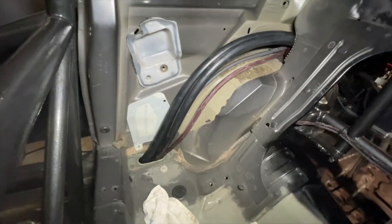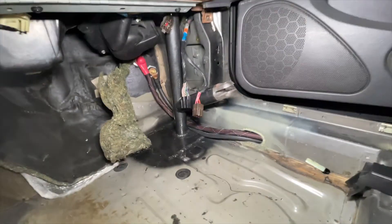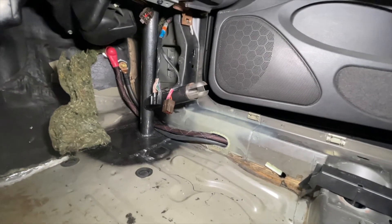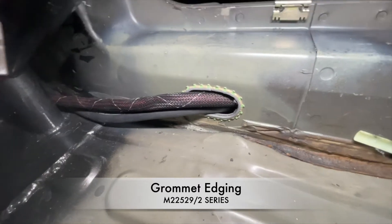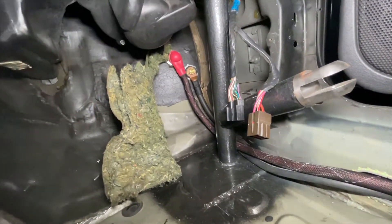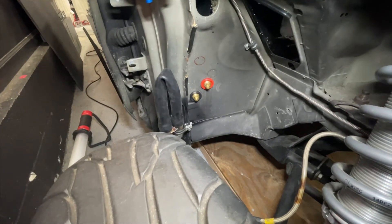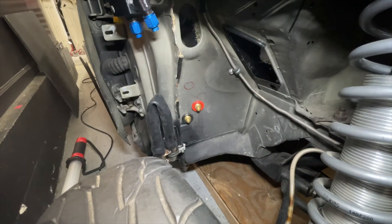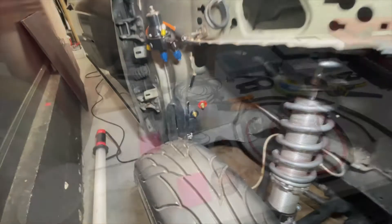That's the slot I cut — previously discussed — where the wires and hoses go inside through that area and out through the kick panel. I enlarged the holes and wherever I add a hole I add a protective grommet so it doesn't chafe through the wires. I have bulkhead fittings, and everything gets a boot — all the power wires get a boot. We'll discuss what gets connected to those bulkhead fittings.